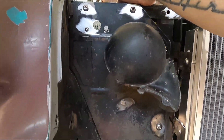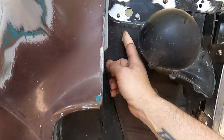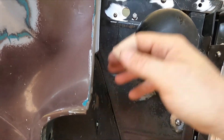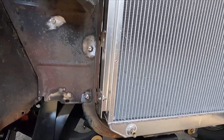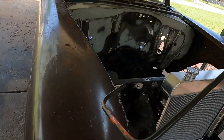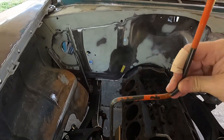After bolting in the coolant overflow tank I've got this area right here that's free and open straight back. The coolant bottle is probably just to this side of this black line, so I've got this open spot where I thought I'd step-bit holes and put grommets for the AC lines to go through. I had this spare piece of 5/16th line mocked up a long time ago — I'd actually used it to hang parts on and paint for my hardtop — but I'll sand this down and paint it black so it kind of disappears.